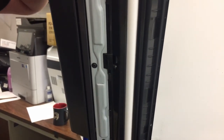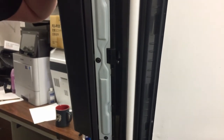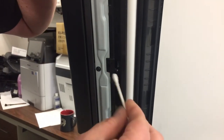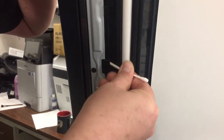What happens is that sensor gets really, really dirty because of dust from your paper. The way to clean it is you can either use a soft cloth with a little bit of isopropyl alcohol, or in my case, I'm going to use a Q-tip today. What we are looking to do is to clean this sensor right here and this plate right here.